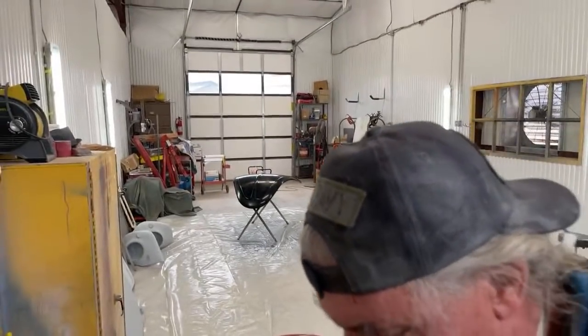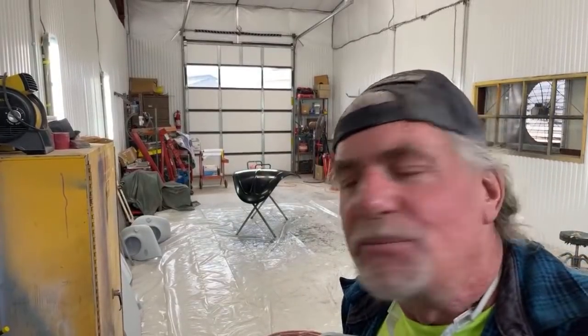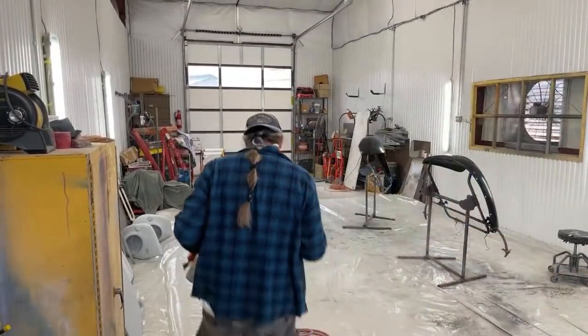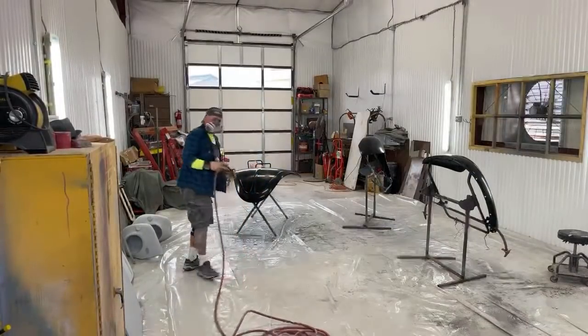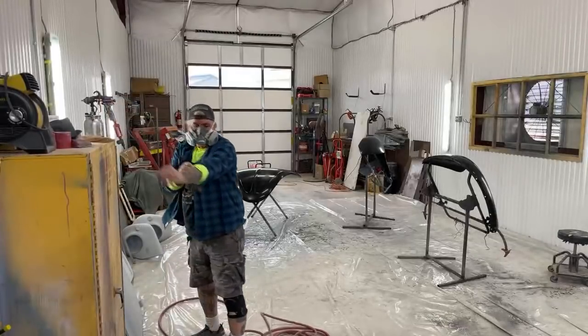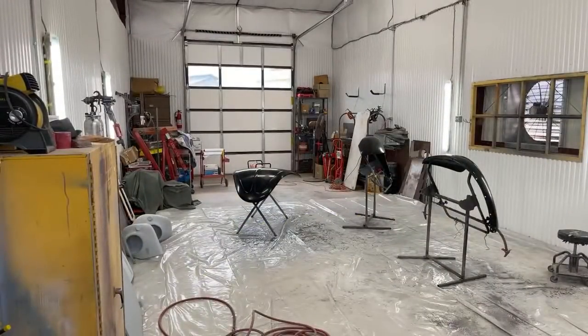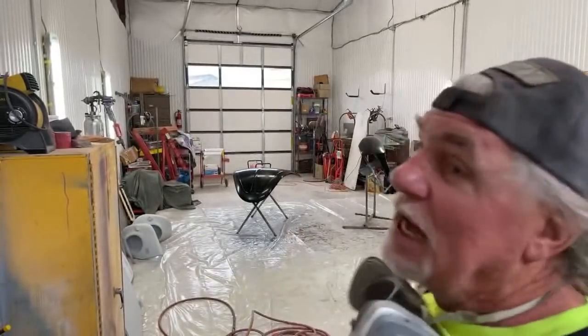Now, I want you to watch, and I'm going to show you when I get done. I want you to see how liquid glass this looks just from using the DBC 500. We definitely don't want to paint with this on. When you shoot your clear coat, don't ever wear anything like you just saw me take off that is going to create static electricity. Very important on that too. Let's get this clear coated. I still got a car out there that I got to do.